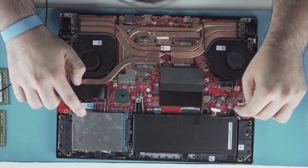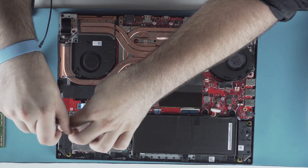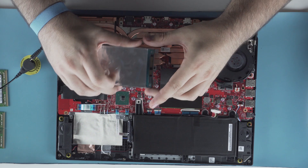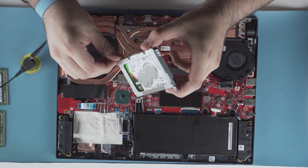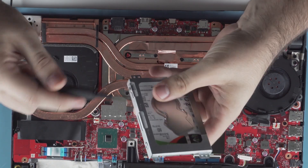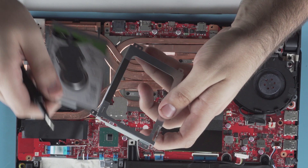Last but not least, we're going to replace the 1TB drive with a 2TB. We just need to be careful and work around it — there should be four screws securing the caddy. Now we have the four screws out, let's get the caddy. As you pull it out, be careful: there is a ribbon cable that runs to the SATA connection. Remove that before you remove the drive or you'll damage the connection. The drive is secured in the caddy with four screws. It looks like a 7mm drive with room for a 9.5mm drive, so there's room for expansion. Note the orientation of the drive so you can put the new one in the same way.